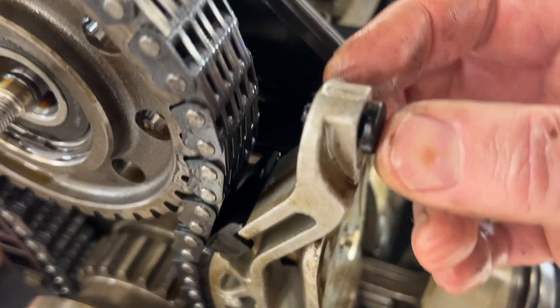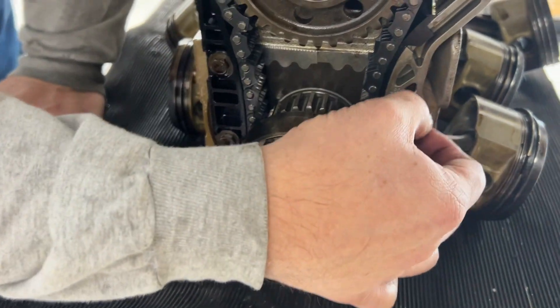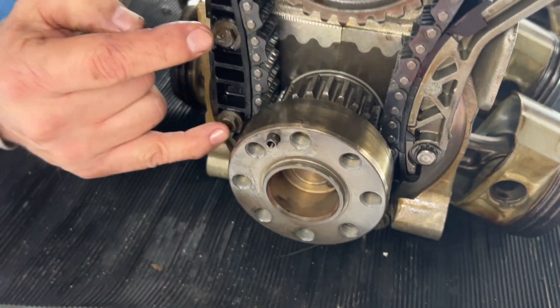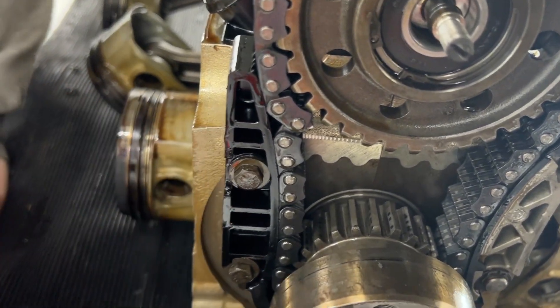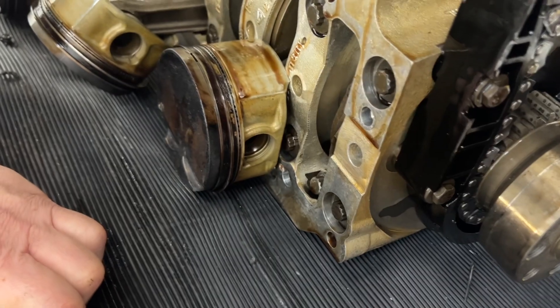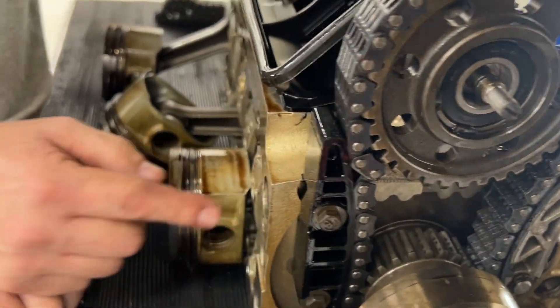I've got a list of all the stuff. Make sure you keep the circlip and the O-ring. Make sure you keep these bolts — they have a built-in washer, so they're super special for some reason. The bolt that we were seeing from underneath was probably one of these two. So don't take that out — hopefully I'm not going to take my crankcase apart. I would have to buy a new one if I took that out. Alright, awesome — so now it is on the table.